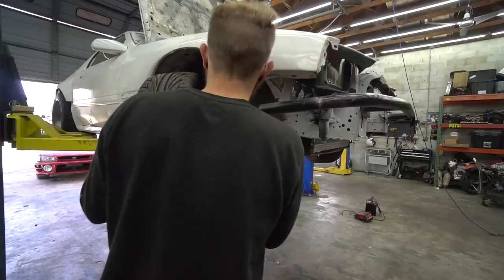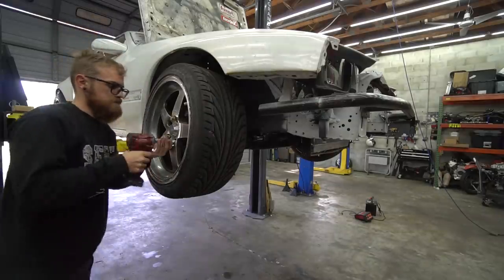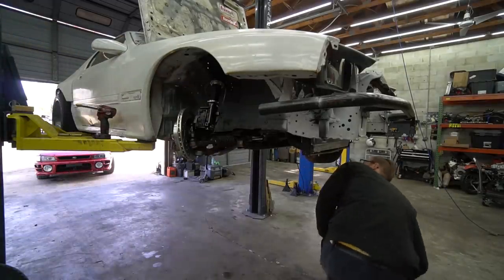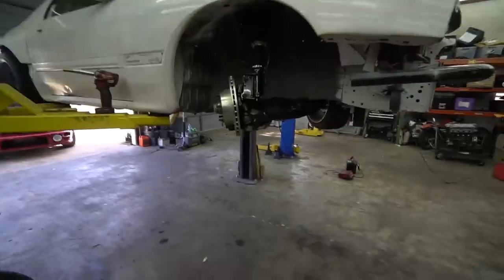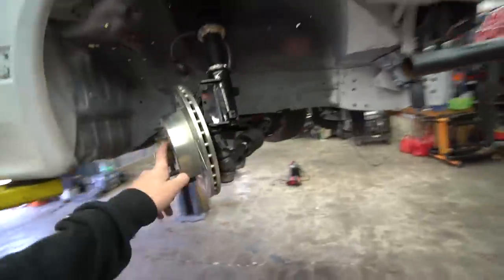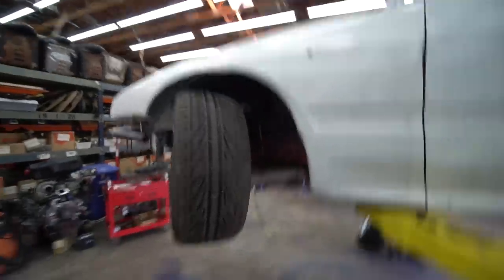We're hitting on the control arm — I don't even think we're maxed out. Wow, dang — that's full lock, that's solid, that's super solid. Angle never looks as crazy as it is. That might be as much as 60 degrees — I'm really happy with that. Again, that's no tie rod spacers. We are going to need to put the front wheel spacers on because we're hitting on the control arm, and the trailing wheel is real close to the frame rail — we'll probably hit it under load. But man, I am so happy with that.